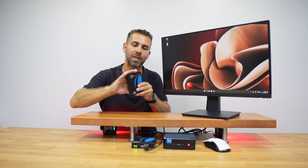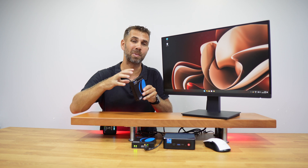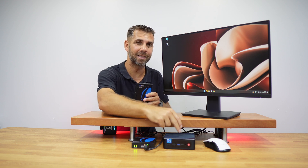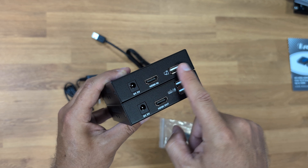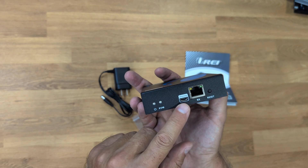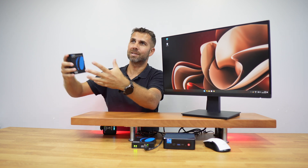One thing I really enjoy about this unit is that it connects to the network rather than directly transmitter-to-receiver. The devices get an IP address and are discovered on the network, which is really cool. I connect to my switch and then have one workstation in one room and another in the living room, all while the computer stays in place. On the receiver side, I connect power, an HDMI cable to the display, a keyboard and mouse, and an Ethernet cable to the switch — and that's it to receive all data and video from the main computer.